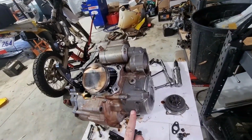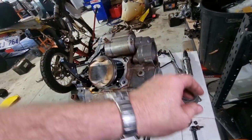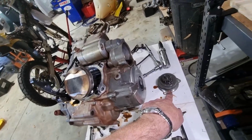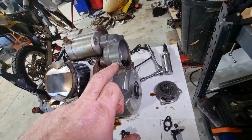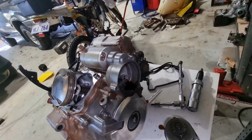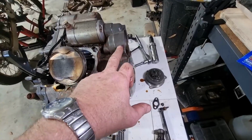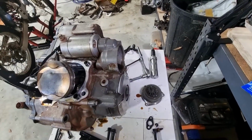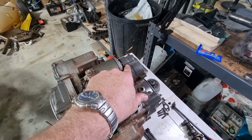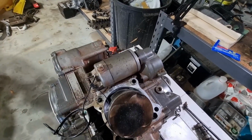Okay, so I've loosened these 8s off. I assume due to lack of bolts on this side that there was something behind here, so taking off this starter motor drive. Looks like we've got an O-ring here. Hopefully I've got a replacement. And it looks like, yeah, we've got an 8 mil in there. So yeah, that'll be, I think, the last one. Impact driver on these all the way, really tight. Okay, so starter motor off. It's obviously running in a bush here, and also gives me access to under here to clean things up.